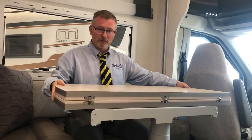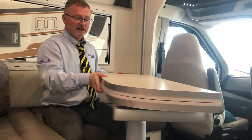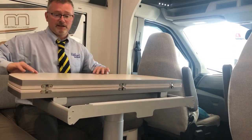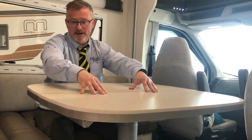We're now moving into your lounge area. You have your electric bed above and your dinette bed here. Starting with the dinette, the table is locked in position — there's a catch on your left-hand side; lift that up and you can spin the table to wherever you want it and lock it into place. When turning the table over, pull the bar out and flip it — that will give you rigidity so if you're leaning on it you won't break the table.